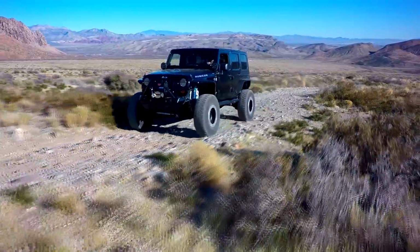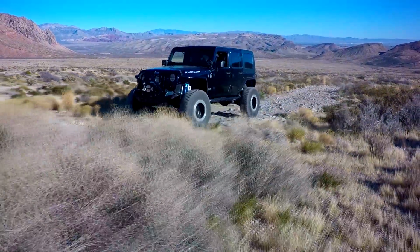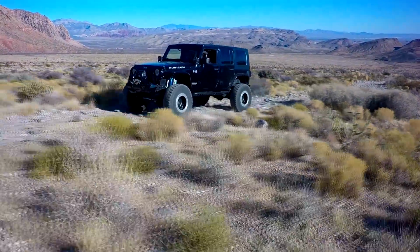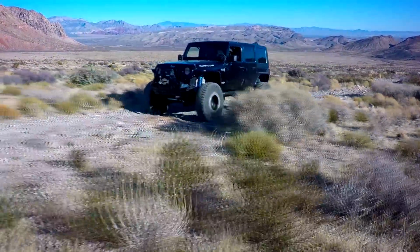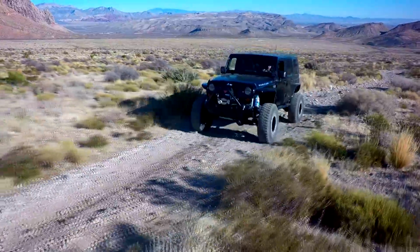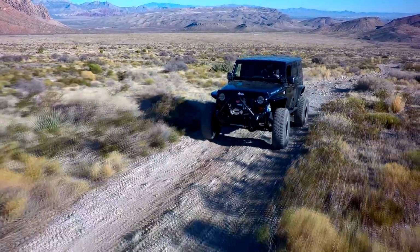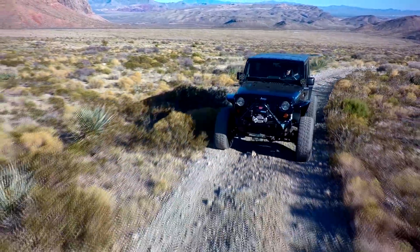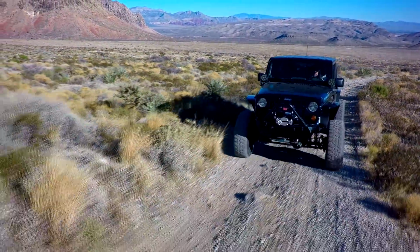I do recommend you run catalytic converters. Unless you're running a 480 or a 525 horse LS3, run catalytic converters. They're not going to hurt the performance much. They're going to give you better fuel control running upstream and downstream oxygen sensors, and they're going to take a lot of crack out of the exhaust that the muffler's not going to have to. As well, on an AFM motor, they do tend to mellow them out.